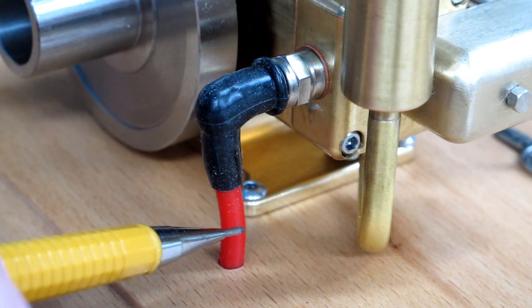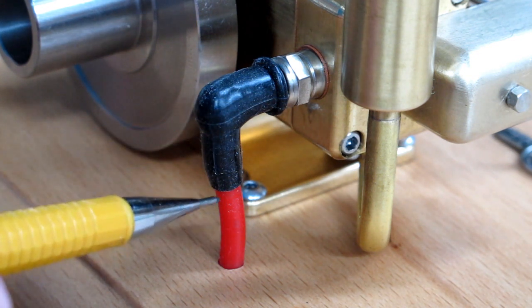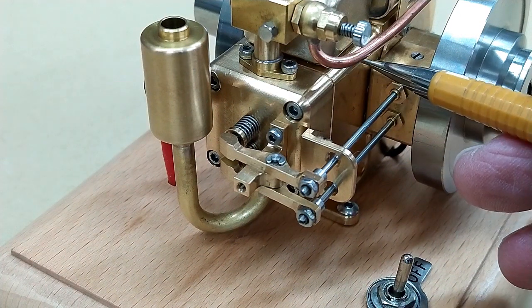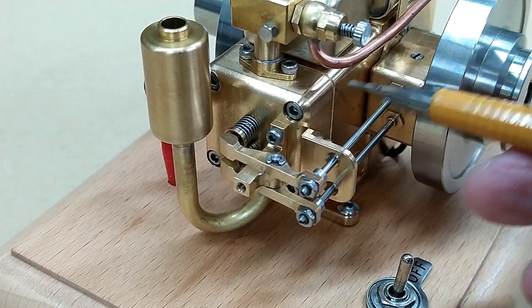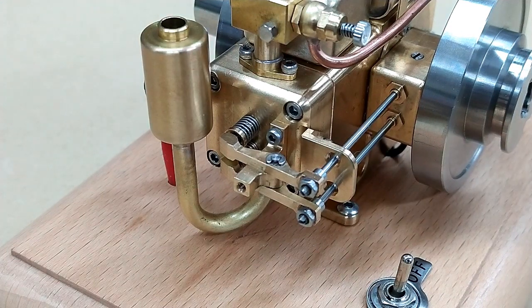Turning the lights out — it has good spark. There is no mechanical connection between the plug wire and the spark plug; this boot just pushes onto the plug. The wire is cut off flush and pushes up until it just touches the end of the plug, and that's good enough. The head bolts were too long and were nearly bottoming out in the threaded holes in the block, so I've shortened those by two or three millimeters. If the head bolts bottom out, the head will not be able to compress against the head gasket — that would be another reason for not having compression.